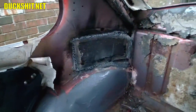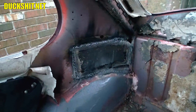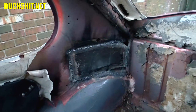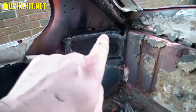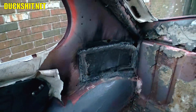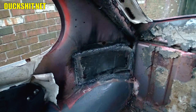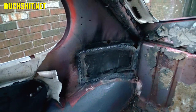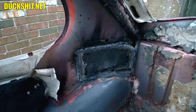We're starting to lose a little bit of daylight and I think I'm at a great stopping point. I want to go over those welds one more time just to smooth them out so they sit nice and flat. They always look like little BBs when you just hit those spots — I like to just run over it real quickly and melt it all together. Still need to create a triangular piece for the corner up in there as well. But otherwise I think we're in a great spot. And you know what time it is? It's time for Taco Tuesday. I'm headed over to meet Wild Bill right now. Leave your like and comment and subscribe — don't forget to pluck the dingle belly.